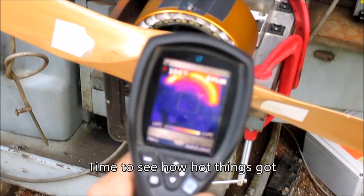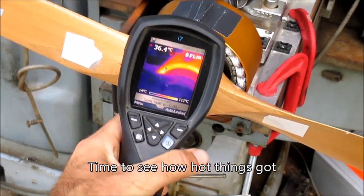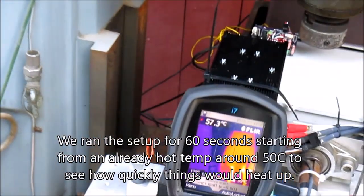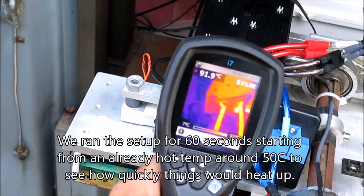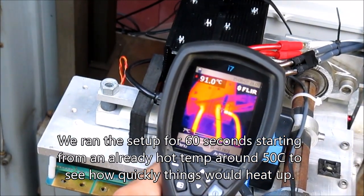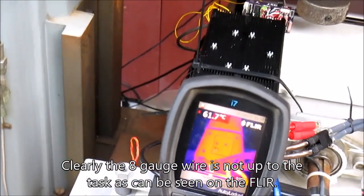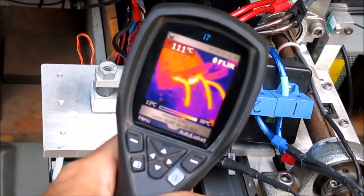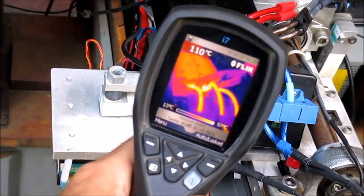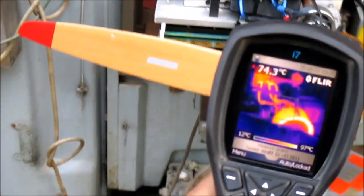It could have gone 2 minutes. Motor's kinda hot — 120. The wires are kinda worn. The controller's good. We are current limited at 120 amps DC. We can bump the voltage — we need to bump up the current a tiny bit to see if we can get some more out of it.